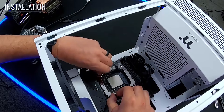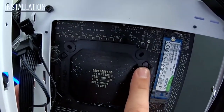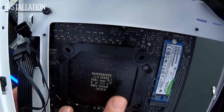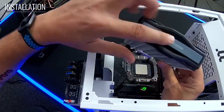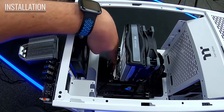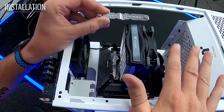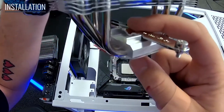I'm just going to hand-tighten these to give me a nice secure hold on my case. You can see on the back with the bracket you just want to make sure these guys stay in their little grooves all the way around, because you want the added length — it's really important for how everything matches up. This has got good tension on the back pushing through to secure the bracket on the front. Now, you can't install the heat sink with the fan pre-installed because you have to put this retention bracket in first, and the only part that really requires a tool is getting the heat sink in with no fans on it at all.